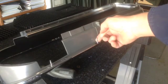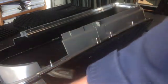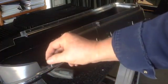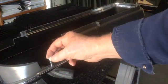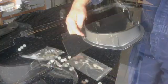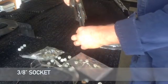The long studs on the outer grill trim are smooth. You need to cut some threads into them using metal speed nuts. You can do this after you place the grill assembly onto the header, but if you want to use nylon nuts, you need to cut them before you install the grill assembly. Nylon nuts are recommended if you worry about rusting speed nuts later.